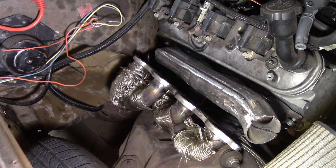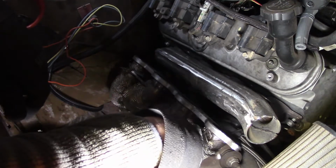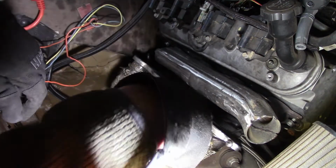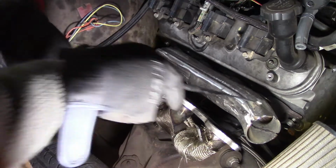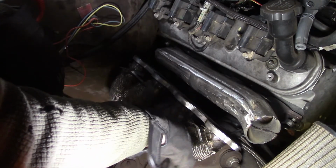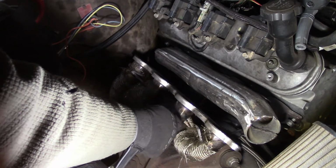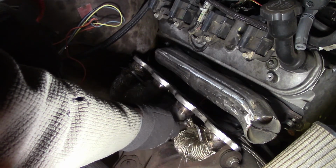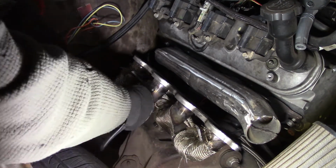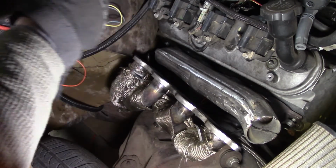Who knows? Yeah. So one of the biggest ways you can tell stainless, stainless handles heat because there's a lot of heat. And these are actually not stainless. They are, notice that's sticky? That's steel. Well, definitely a steel adapter, mild steel, but those are stainless headers. I'll be dang. What do you know? That is not sticky, just like that. It is not sticky at all. Good headers. I didn't even know it.